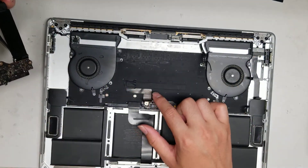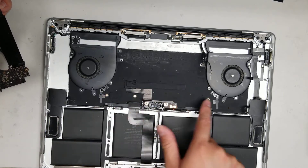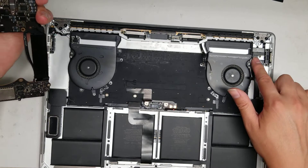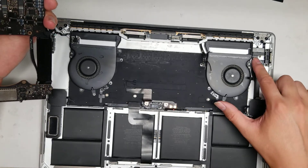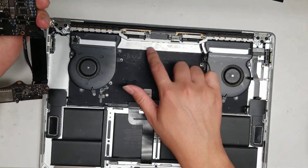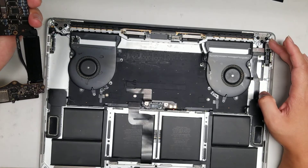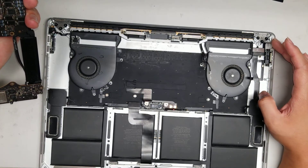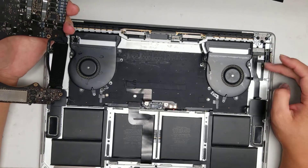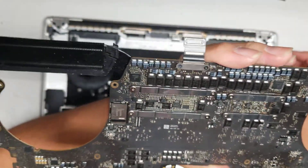With the board out, you can see this connector was for the keyboard — they actually built the fan connectors into the keyboard, so the fans connect to the keyboard. This other connector is for the touchpad or the touch strip. The touch ID strip with all the touch buttons actually has two connectors going into it. And that connector there is for the microphone.